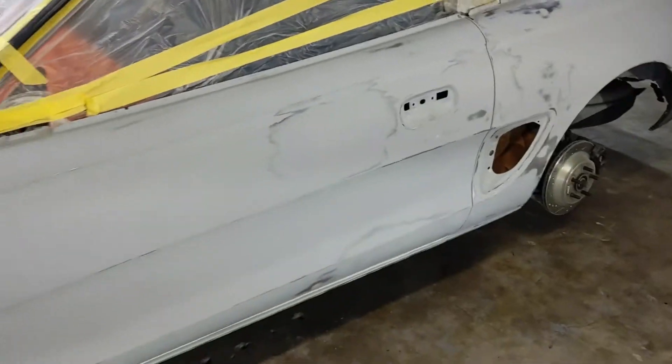We also learned how to not tape up the edge at the bottom of this door. If you use 3M foam tape, make sure on the inside of the door you put some masking tape facing the outside. See that gritty stuff? That's where the 3M foam tape soaked in - and part of this is my fault because look how thick I caked it on. It's 100% my fault - just inexperience. It's supposed to keep you from having a tape line, but that doesn't work if you're caking it on because you're having trouble with your gun. Problems are compounding - this is where experience comes into play.